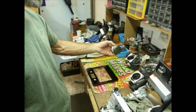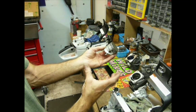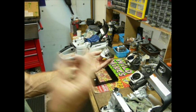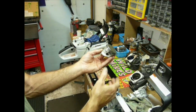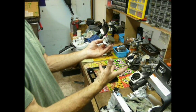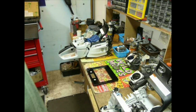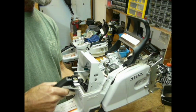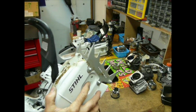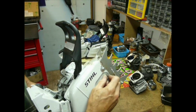You better warm them up good before you get rolling. And you better have a super dense mix oil, to help take up some of the slack. Not to mention you want an oil that has good film strength, and you want an oil that has good viscosity to handle the heat in the process. If we take a look inside here, so they redesigned the cases, obviously. So that was a must-do if you're going to shed almost 2 pounds.